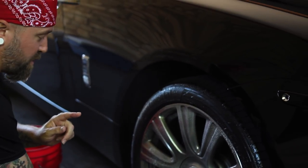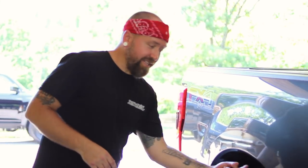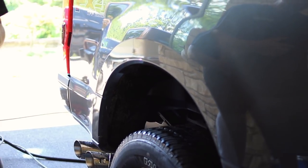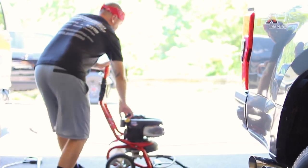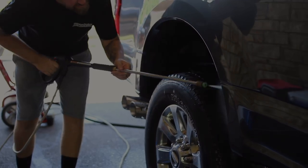We have a dedicated video specifically for wheel and tire detailing. After decontaminating and cleaning the wheels and tires, address the fender wells before beginning the wash. On this F-250 there's a lot of exposed chassis in the back and plastic fender wells, plus carpet fender wells up front. Use an all-purpose cleaner or degreaser, brushing or pressure washing in there - get all the crud knocked out of the fender wells and suspension before starting the wash.